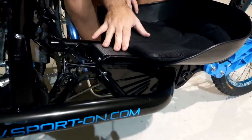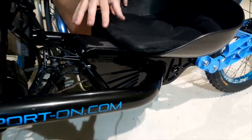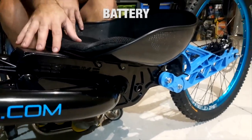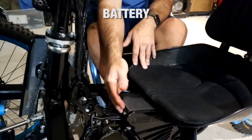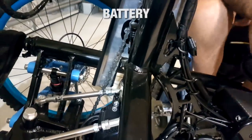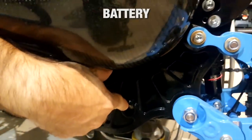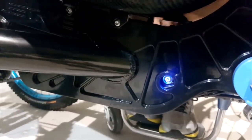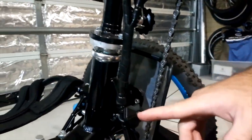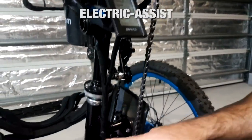The only part of this design I'm not entirely happy with is the fact that you have to unbolt the seat to recharge the battery. We have done some basic modifications to be able to charge it through an external port at the front here, but it just means the battery has to be switched on to do so. There's a hole here for the power switch — you can quite easily reach in and turn the power on for the battery. You'll have a little blue light in there telling you it's turned on. Press and hold the on button here and your screen comes on.